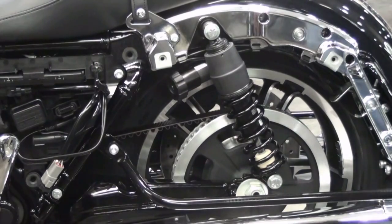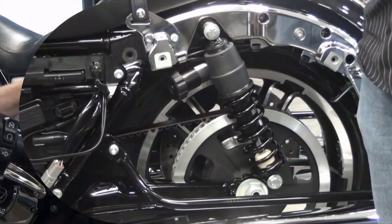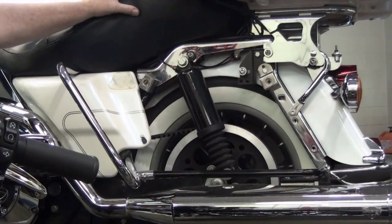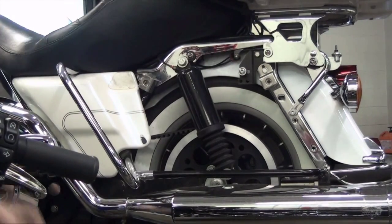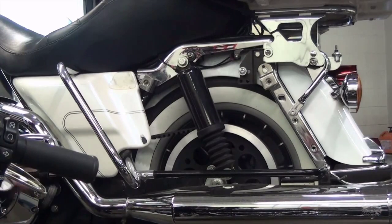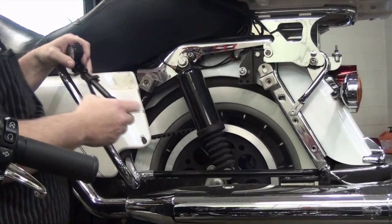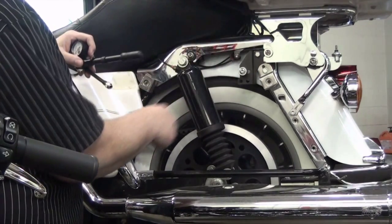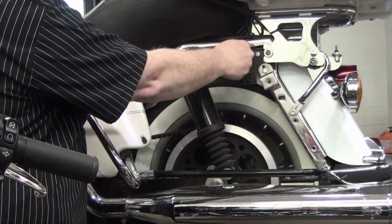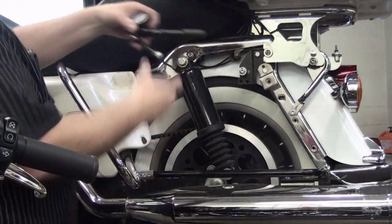Awesome. Well, stay with us, and we're going to head to the older motorcycle and show you how the air suspension works. Okay, guys, we are at the earlier model motorcycle that's got the air suspension on it, and Ted's going to explain to you how you fill these up and adjust the preload on one of these. These here are air-assisted, air-over hydraulic shocks. They've been used for years on a lot of the touring bikes that Harley makes, and they have a Schrader valve with a cover that you would take off. And you want to use one of these kind of pumps.